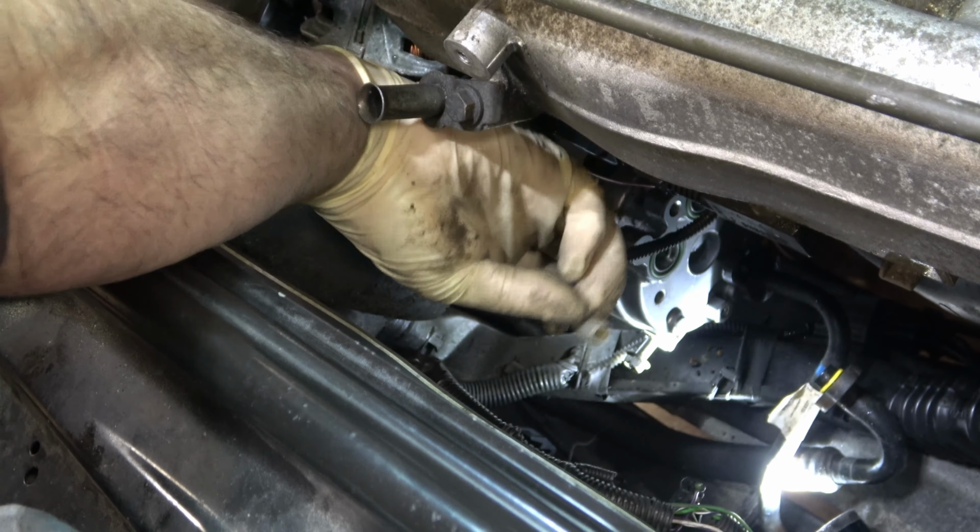And we're ready to put our radiator fan shroud back in. Once you got it down in there, you got to kind of put everything back into its little nook. You don't want to pinch the expansion tube for the radiator, and we certainly don't want to pinch any wiring. Hey, that side looks good. Let me get a flashlight, look down on this side, make sure that our hoses, our wiring here didn't get pinched. And I'm going to reattach that to the holders here. You really can't see this, but that's it right there.